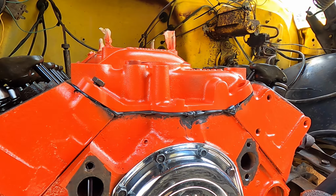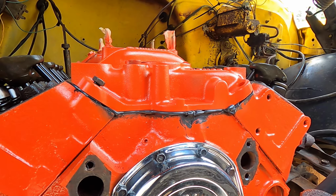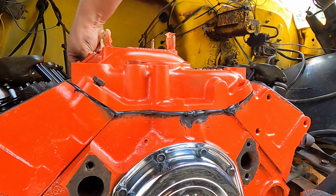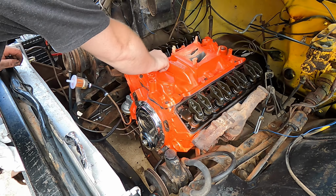So these are gonna come back out, and one of the reasons for that is they need to be sealed because there are some open galley ports for oil passages, and if that's the case, oil can come up through the threads when they pull on the intake, and it's not fun. So I'm gonna get all these in that I can, and then we'll come back and get them tightened up. Okay,